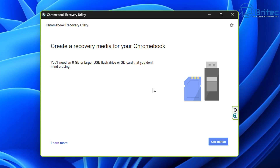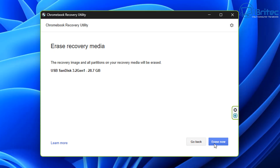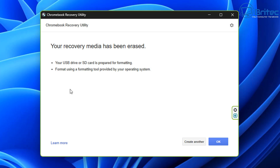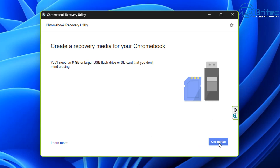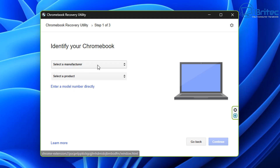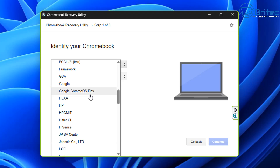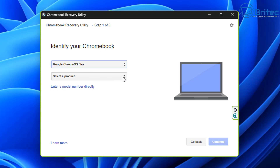Go up to the extensions area and click on Chromebook Recovery Utility to open the application. Inside the utility, go to the cog icon in the top right and select 'Erase recovery media.' This will erase your USB flash drive and prepare it for installing Chrome OS Flex. Once done, click 'Create another.' Then choose your model — go to 'Select a manufacturer' and select Chrome OS Flex from the list.